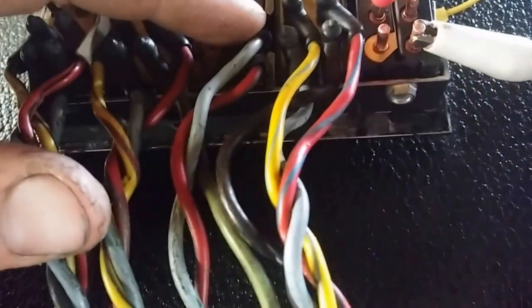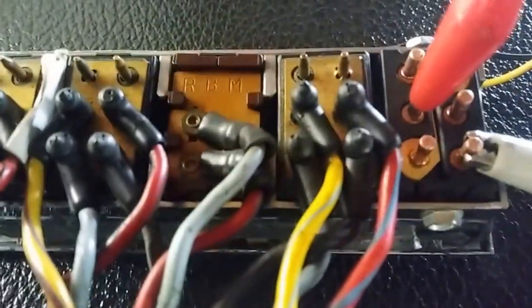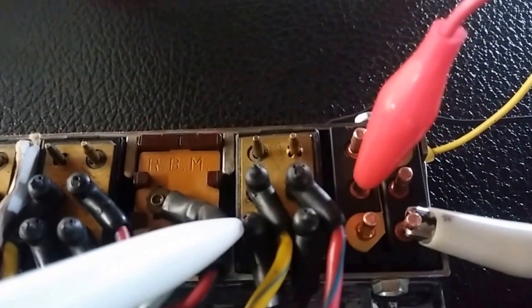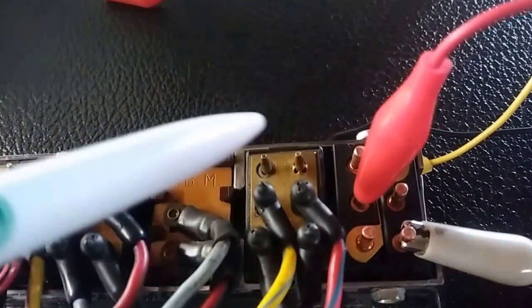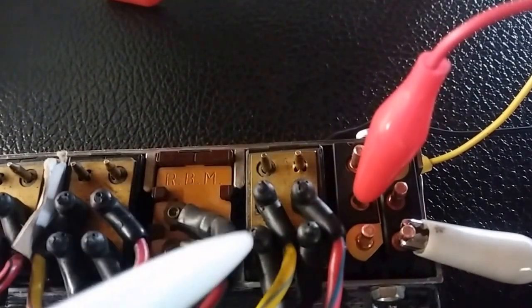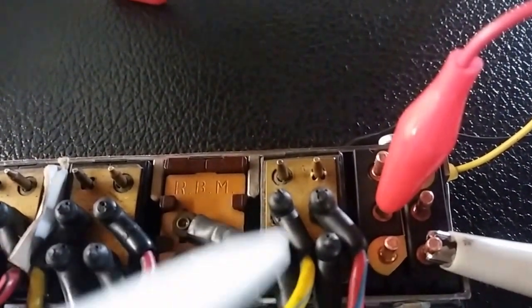So what I had to do here is, this is the normal wiring, so you can see these. This gray wire right there, that guy is hot, this guy is ground. These two are different signal wires for up or down. Now on this one, the ground and the hot are connected to these pins up here sideways like this. So what that does is when you reverse the switch, that's what's able to give you up or down on this one.